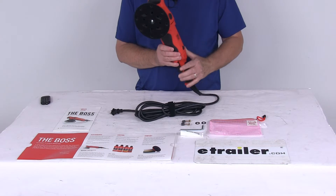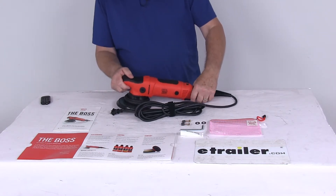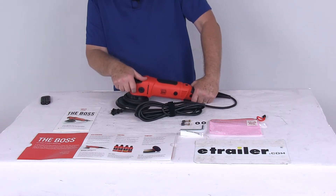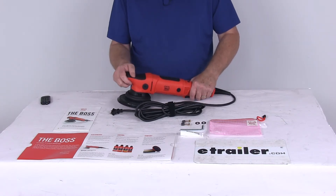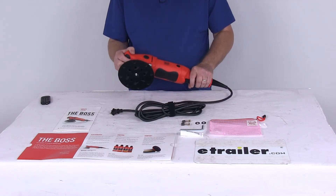This is a dual action machine that will let you achieve your desired polishing and waxing effect. This can be used for correcting, which means removing major scratches and blemishes with a polisher compound; for perfecting, which will remove minor scratches and swirl marks with a mild polish; or protecting, shielding the paint finish from the elements with a nice wax or sealant.